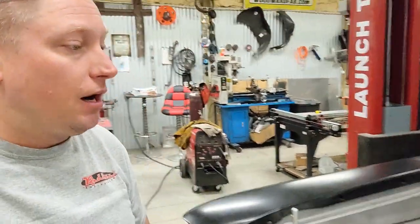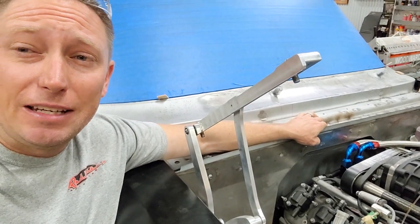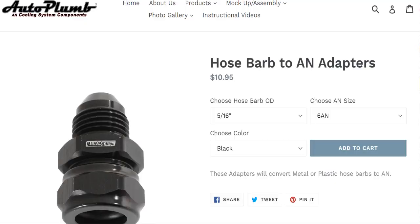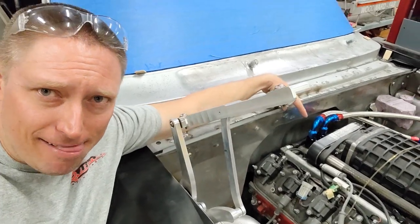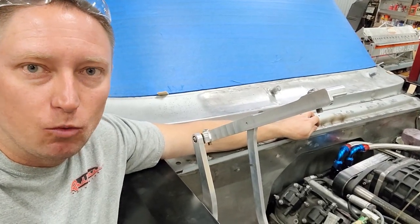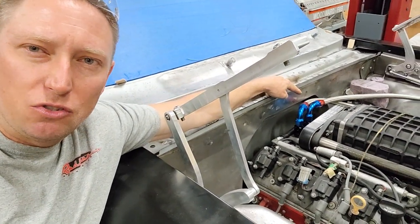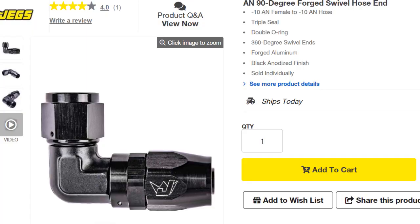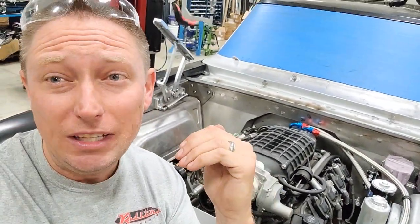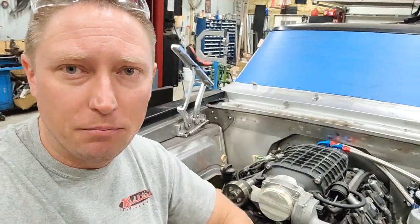One of the things I'll share with you is back here in the back of the motor, you can see I've got those fittings right there. Those are not 10AN threaded connections — I actually had to buy some adapters from Autoplum that would allow me to hook up threaded lines to those. I'll put a link down below to Autoplum where I got those little adapters. I'm also going to go back and replace that 90-degree port right there with a low-profile one, because those two fittings are just right up against each other and hitting each other. I'm going to have one that's a really sharp 90 and one that's a big curving 90 so hopefully those hoses just follow each other and don't bump into each other.